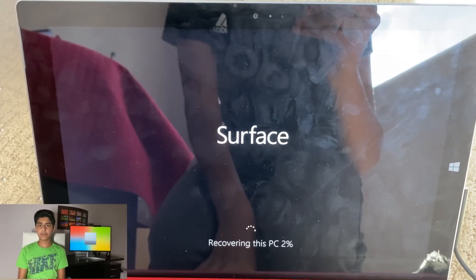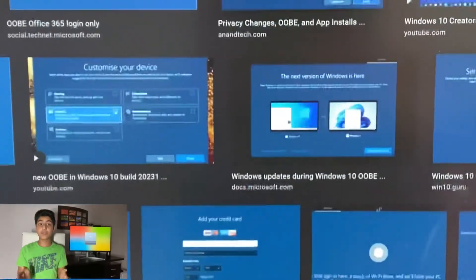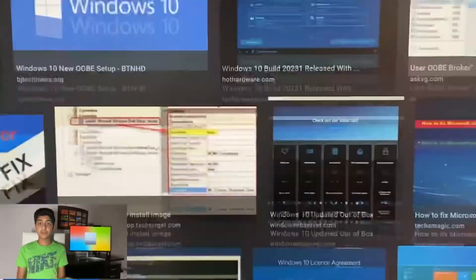After around 15 to 20 minutes, the Windows setup screen should pop up. You should see a Windows 10 setup screen if your Surface came pre-installed with Windows 10, a Windows 8.1 setup screen if it came with 8.1, or a Windows 11 setup screen if it came with Windows 11. Once you've gotten to the setup page, you can safely unplug your USB drive. You have now successfully recovered your Surface and the operating system installed on it is good as new. Thank you so much for watching — please like and subscribe. I hope this helps you with your Surface problems, and I will see you in the next one!